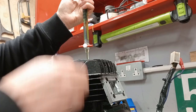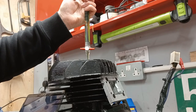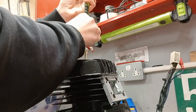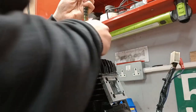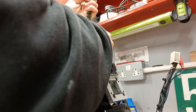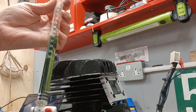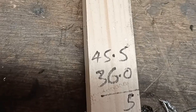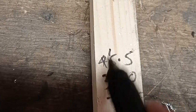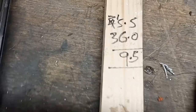Just checking the compression ratio on what I've got at the minute. I know I've done it before, but I'm going to do it again just so I've got an absolute definite before I modify the head. So I'm starting with 36cc in there, and I'm going to fill it up to the bottom of the plug. I'm now down to — gone to 45 and a half. So doing the maths: borrow one from there, so that's 15, so that's 9, that becomes a 3, so 9.5cc.